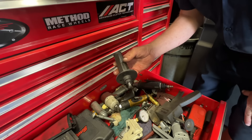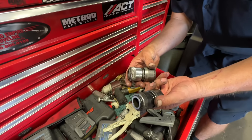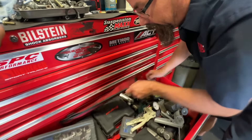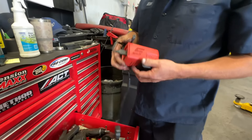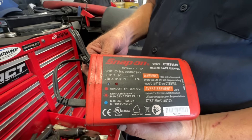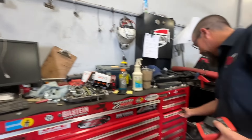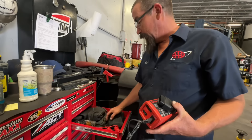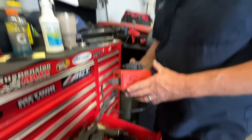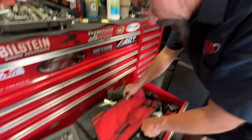I've got quick chucks for my air hammer. And one last thing — this is a memory saver from Snap-on. Unfortunately it's a bad one. If there's any problem with the car's OBD2 connection it will not keep memory at all. Unlike one you hook up to a jumper pack — which just works — this one will shut off if there's any problem on the car side. I do not recommend it; it was an impulse buy.